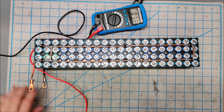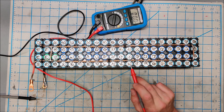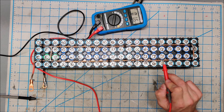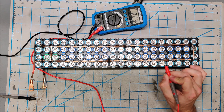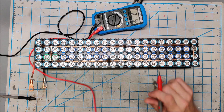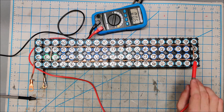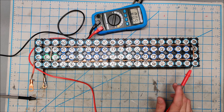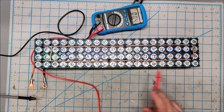This was actually the second pack I made, and I didn't yet have my big soldering iron. I ordered my big soldering iron when I started my first couple of packs because I was having such a hard time melting solder on the bus bar. This fuse wire is not making electrical contact, and even the next one looks a bit suspicious. I think I can solve my problem by going through and reflowing mainly the bus bar connections, though some of the other solder joints don't look amazing either.